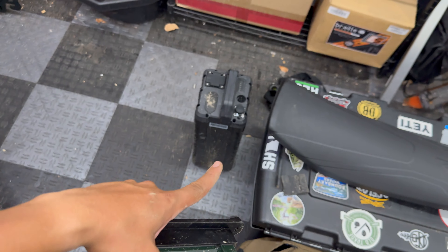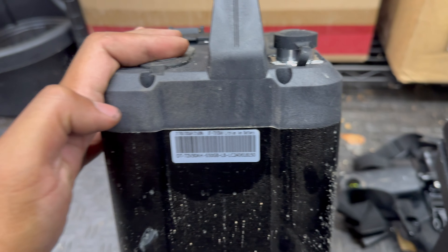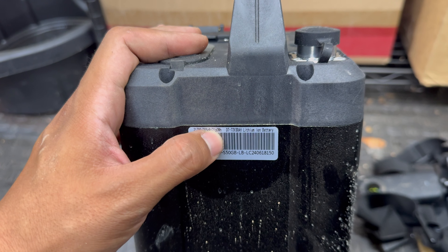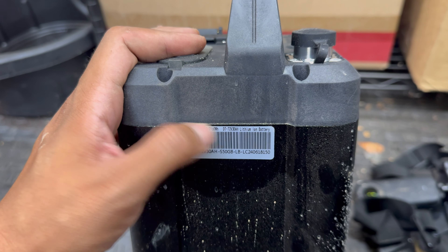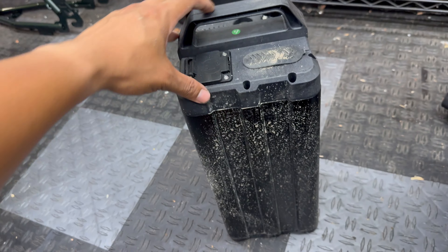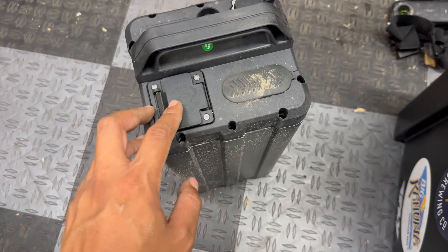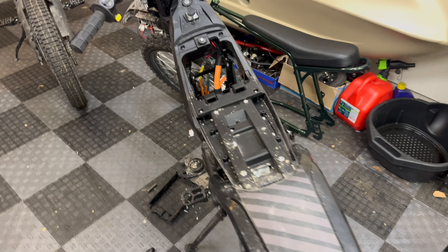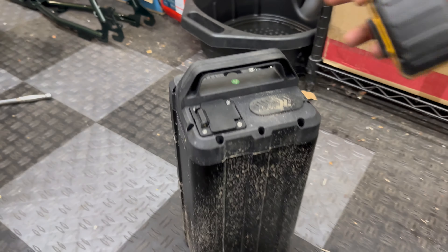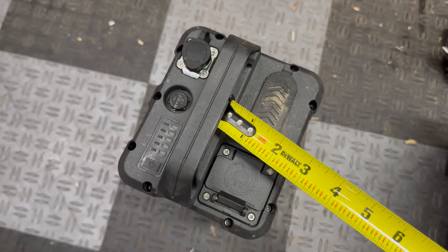There is also a label on the side of the battery that says 21700 — the battery cell type — then 20S 6P, 2160 watt-hours capacity. I don't see anything about what the BMS is rated for. If you guys happen to know what battery management system is in this battery and what it's rated for, please comment below. If this battery can put out more than 90 amps continuous, we're upgrading the controller to see how far we can push it.